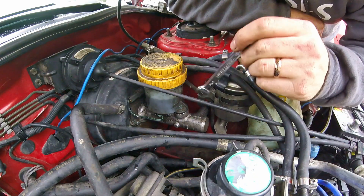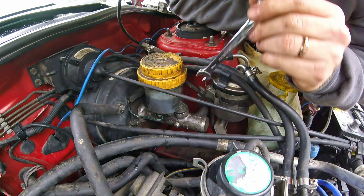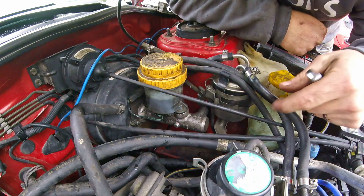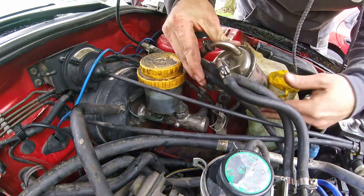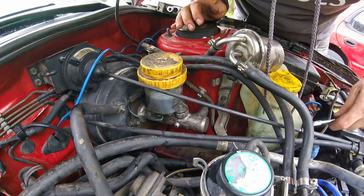The first thing you want to do is come in here and pull off the brake lines off the brake master cylinder. The way it's bolted in right now gives it a lot of rigidity and makes it so you can break these loose if they're hard to get off. Another thing you can do is pop off your fuel filter so you have some more space.